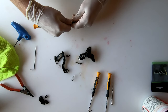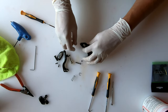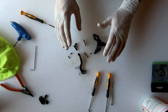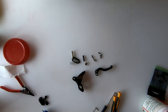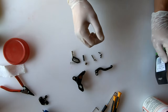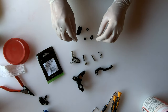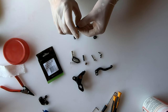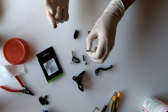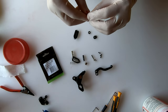Now we have both seals off. Take everything — the master cylinder, plunger, brass barrel, cap, lever — give it all a very good wash, then when you come back we'll start reassembling. After cleaning everything up, take your seal kit and empty it out. You'll get four items inside. We're starting with the primary piston seal as it's the most difficult to fit. Take some red rubber grease and grease the seal nicely, inside and out.